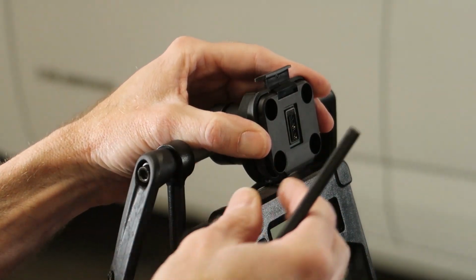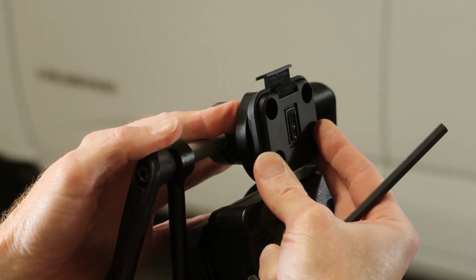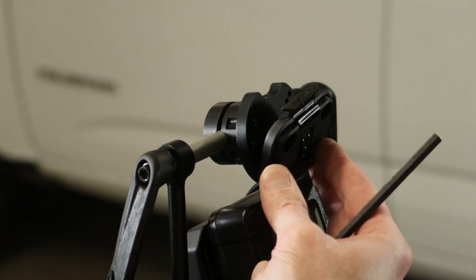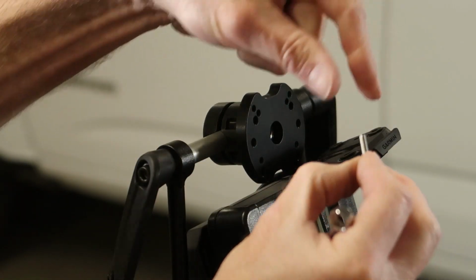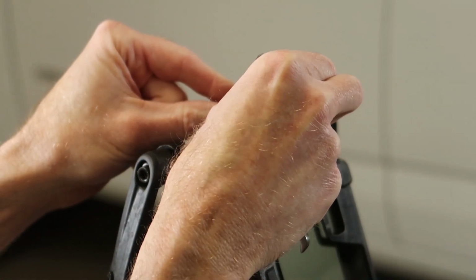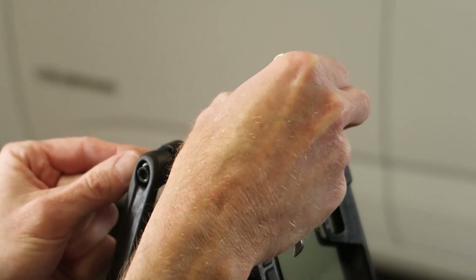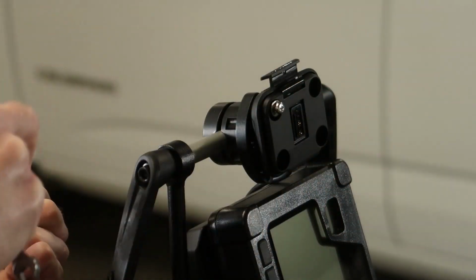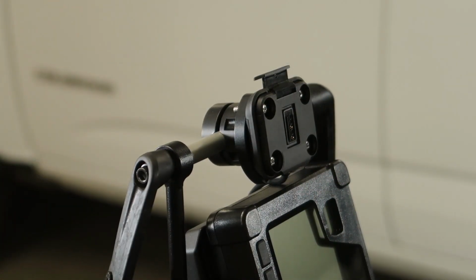We have a nylock nut that goes on the back, and then a Phillips head machine screw on the front. And each one of the screws has a small flat washer on it. And on a Tenere 700, you want to mount this cradle in the upper position. And these upper holes are threaded. And as you can see, this project is a whole lot easier with the windscreen removed.